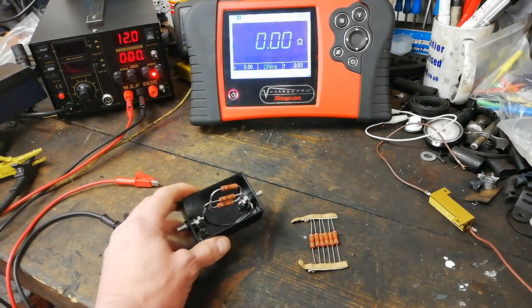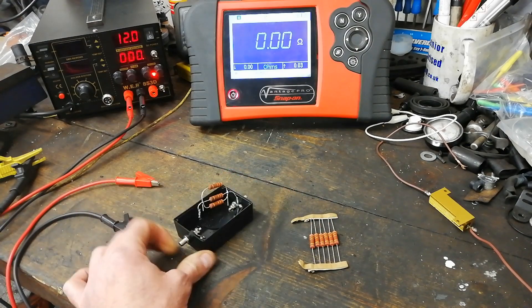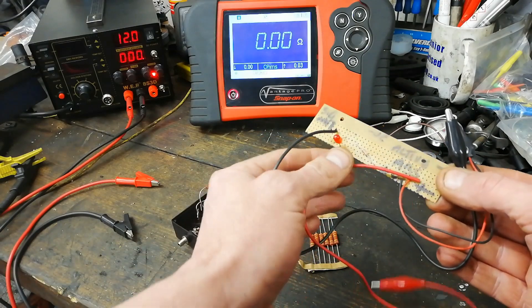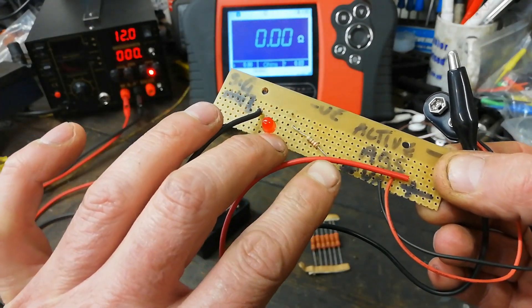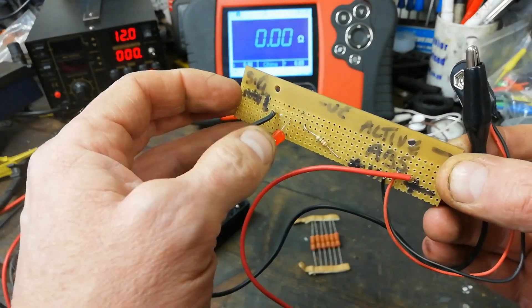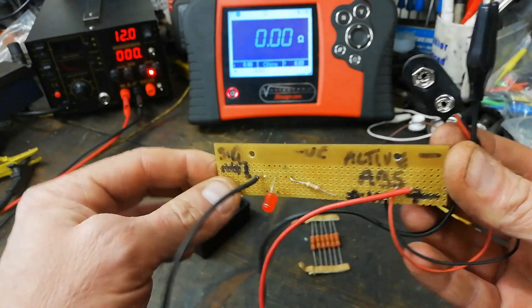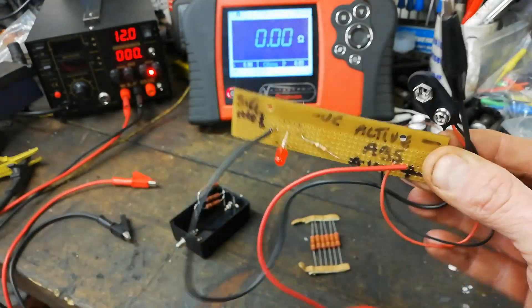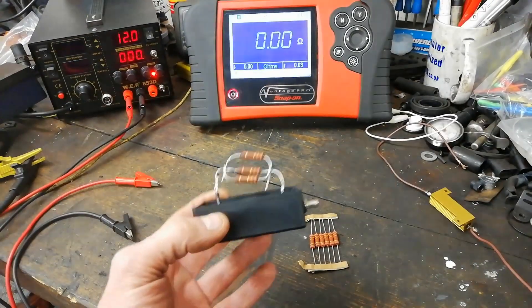This is something I've just been messing about with — this is a shunt resistor. We've shown this concept before on the channel in the form of our wee famous ABS breadboard, where we have a 200-ohm resistor and the LED is measuring the voltage drop across that resistor. It's powered off a 9-volt battery and it's for testing active ABS sensors on the car, independently of the wiring loom or the module. The concept is the same here, but this has another use.